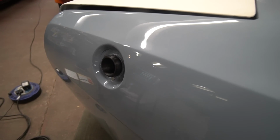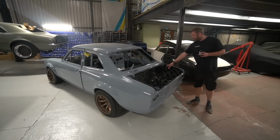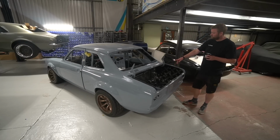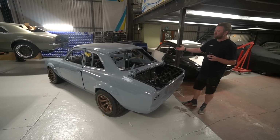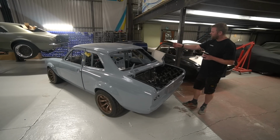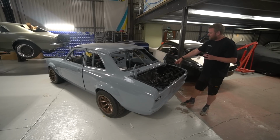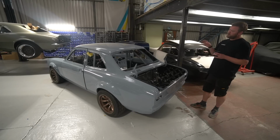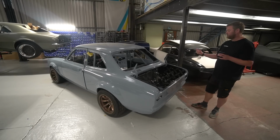Staying in the boot area, Anthony has been on the plates that blank off where the reservoir hoses for the rear struts go. So this is essentially McPherson struts, if you like, but they're at the back, so it's not quite the same, but it's a coilover type strut down onto the lower arm, and they are remote reservoir dampers. And we thought on this it'd be nice to be able to access the adjustments easily, so not having the reservoirs underneath.